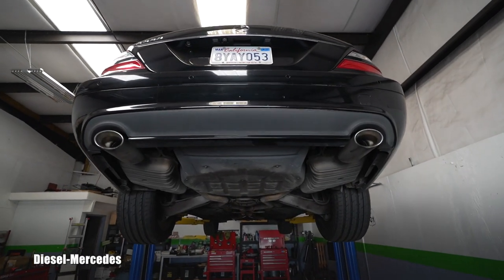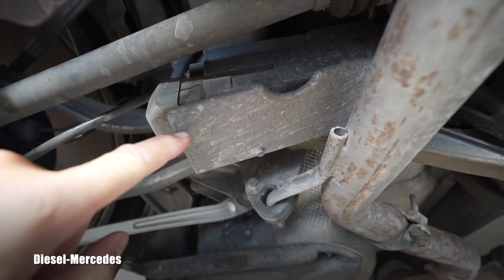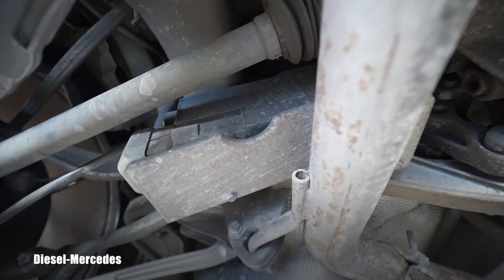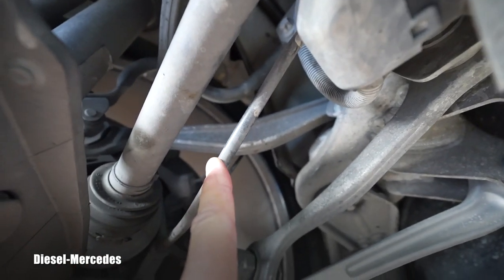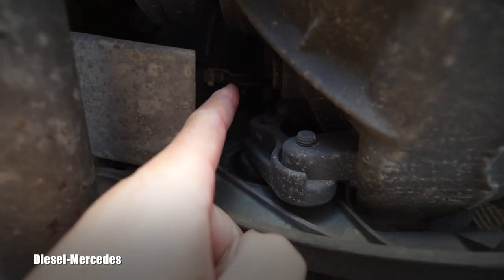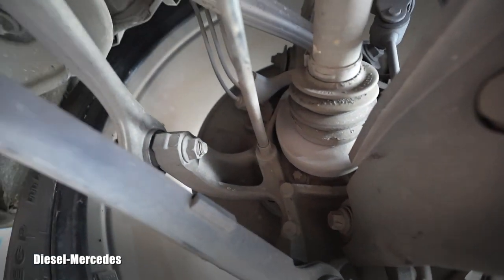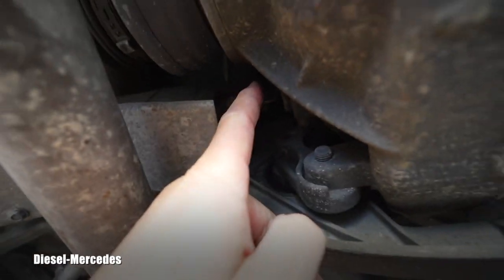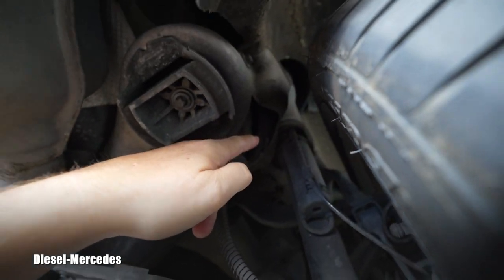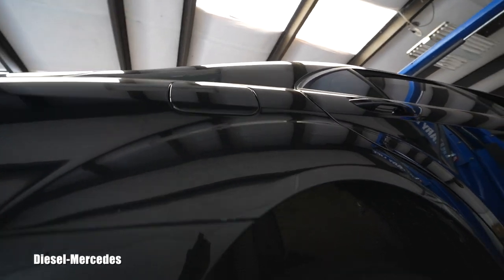If you have a lift it's very easy to see the entire unit from the back. There's a metal shield, and right behind it is the electric box. It splits on both sides — one cable pulls the driver rear parking brake, another longer cable pulls the passenger rear wheel parking brake. A third smaller cable runs through and is guided all the way to the fuel filler cap area behind the door.